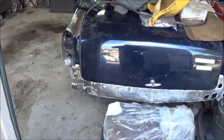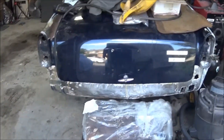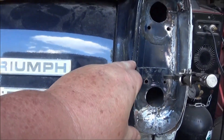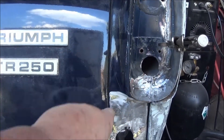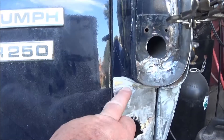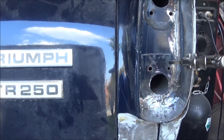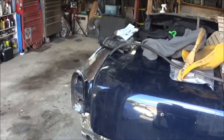Really what I want to do first is clean up this area here a little bit better, because I realize now that I've got a bit of an issue with the rear valence. I had a little issue before, but I've got more of an issue after visiting British Car Day and doing some research. This panel here actually should have a few little cut marks in it — a little cut mark here and there's a little cut mark up here. There's a little panel that goes from here to here, and when it's painted you can still see the lines. Mine has had a significant amount of work done on the rear valence and a significant amount of bondo, so those lines are no longer present.